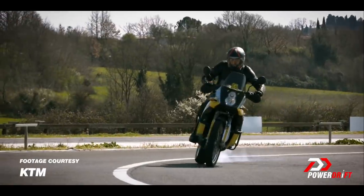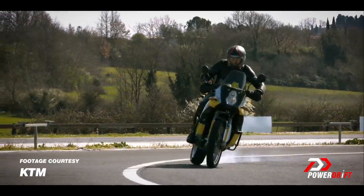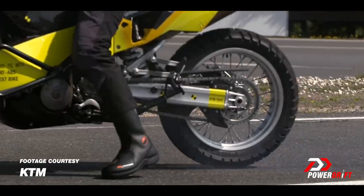How does this system work? In most cases, the ABS system starts with sensors on the wheels that report to the ABS computer the state of the wheels in terms of rotation. Many ABS systems use just one tyre — a single channel ABS system, which only works on one wheel, usually the front. It can monitor whether the front wheel is rotating and calculate acceleration or deceleration. Some systems use both wheels and compare wheel speeds, which is why you'll see slotted rings on both wheels even with a single channel system.